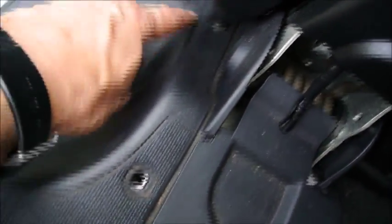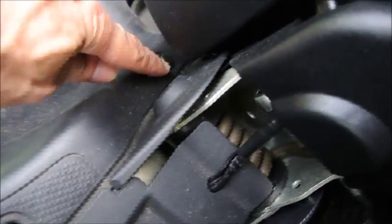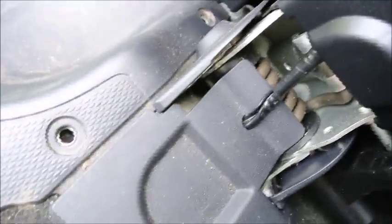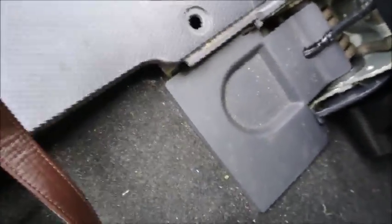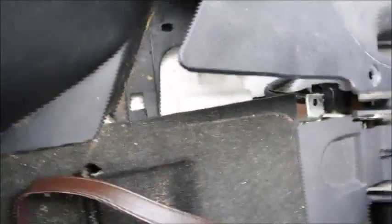At the bottom you need to remove this pin and the other pin that's there. The first one is already removed; the second one I'm going to remove now. You need a small screwdriver — you pull out the pin and then it should go out easily. Store everything neatly. You need to pry this and you're going to be able to pull out this piece of plastic. Then you're going to be able to remove the complete side piece here and access your cable.